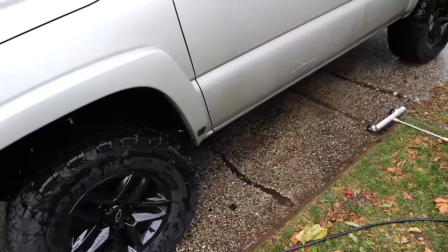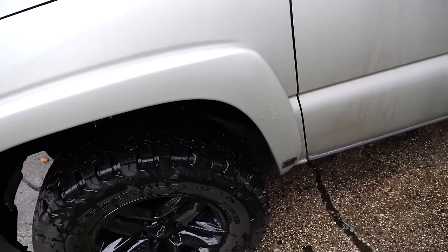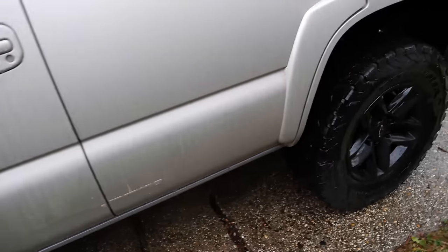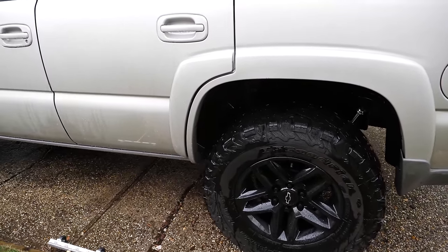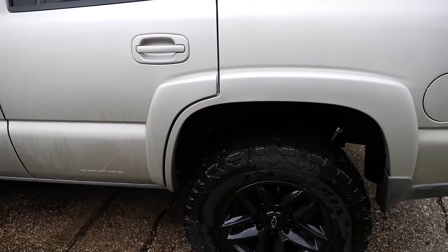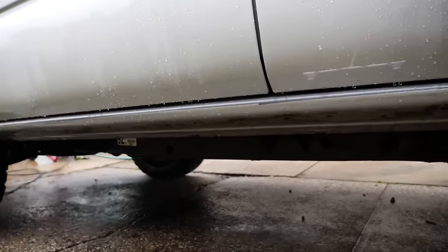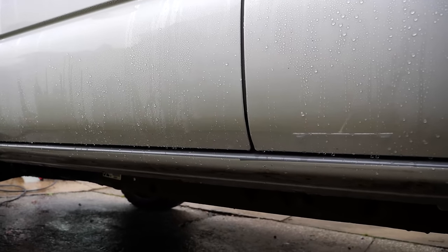All right, so all the cleaning is done. I pretty much just focused everything from here back. I kind of rinsed the inside of the wheel wells, but when I did the shocks and everything with the wheels off, I Pour-15ed and undercoated this part of the frame to the front. I'll probably apply some of this stuff to that area when we're doing the brakes and I've got the wheels off. This thing seemed to work pretty good. I ended up just going straight at it with the pressure washer nozzle itself because I could get a clear shot at the side of the frame here — really blast all that stuff off. A lot of just brown water came off, so I know I got this pretty damn clean.